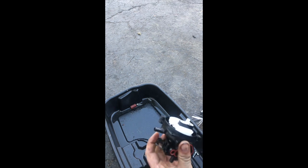So that's that. All right, we're gonna stick the diaphragm in. Like I said, it can only go one way, so you cannot mess this up. Snap in. All right. Make sure this stays. See, the float moves freely, so we're good. We are going to stick this back in like so. Doesn't matter where it goes, as long as the holes line up to tighten it down. Give it a good squeeze.